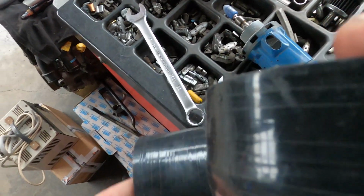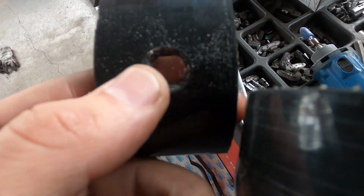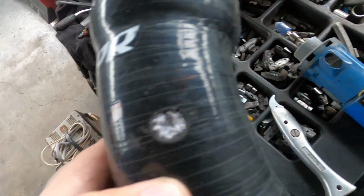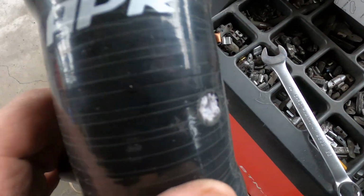And then what I did, I just put it in. It turns so hard that it starts melting and burning the stuff away. And then it's starting to look like this. This was the first try. This was the second try. Here I can fit it through, and it fits good. So what I do, I drill it a little bit smaller here, and now I'll finish it with that. So only drilling will not work, at least not for me.